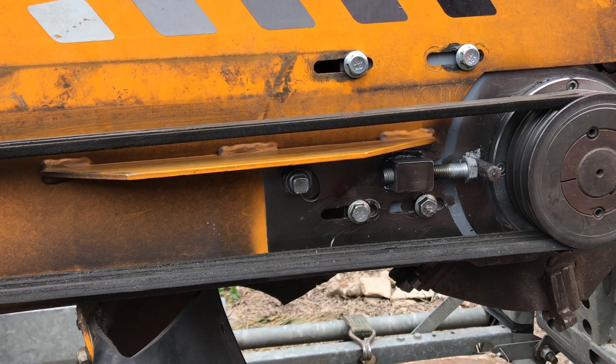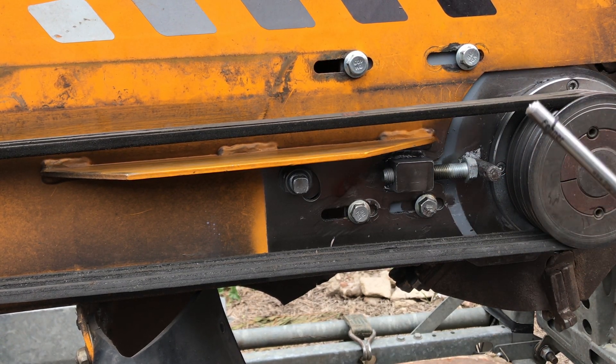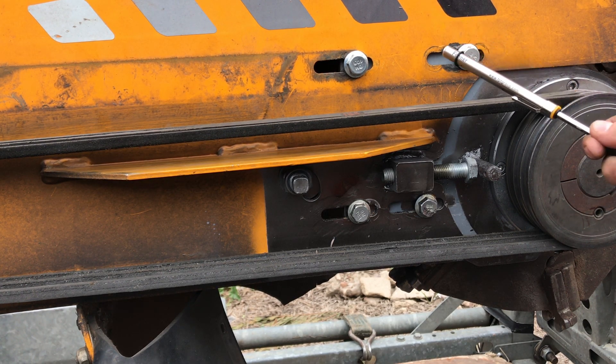This is my Predator 38RX that I've modified the belt tensioning system on. What I've done is I've done away with the original four bolts and put high tensile steel ones in with high tensile captured nuts on the back. That way I can get a higher torque setting on those and reduce the risk of these slipping back once the tensioner is off and it holds everything in place. I was having a few issues with that as you well know.